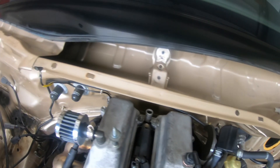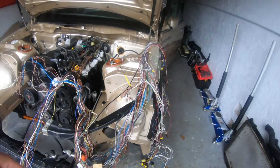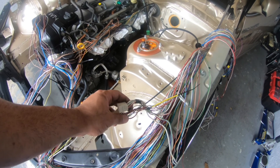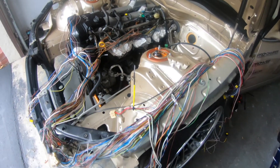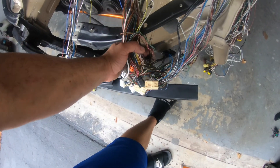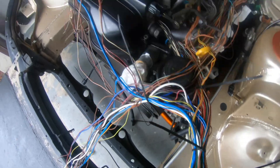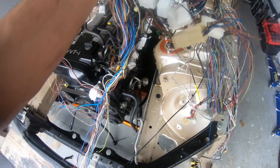I'll run those along this side of the motor to the back and meet them at some type of junction in this area. This is probably the most difficult part I'm going to be running into. I've been grouping them together — for instance, these are the plugs for the relay box, the fan motors, and the AC. These I'm leaving for now. I've also grouped the ones I'm running to the front of the car — for the igniter, the ECU, and some that junction together.